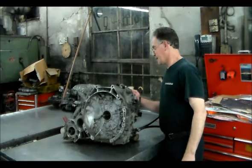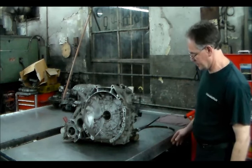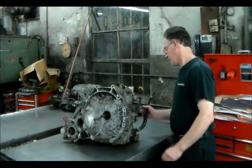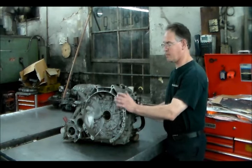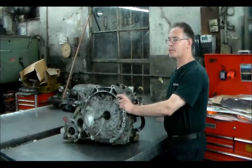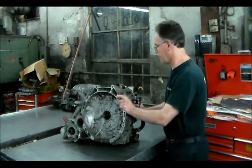All right, 2006 Acura MDX. On the tag down here, the transmission is called the BDKA. We're going to open this up. What was going on with this? This produced a code for pressure control solenoid A performance or stuck off.